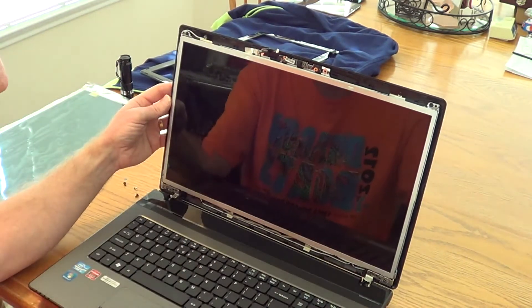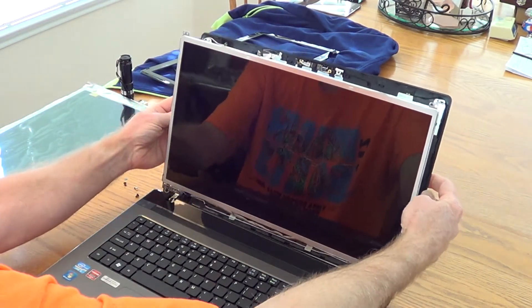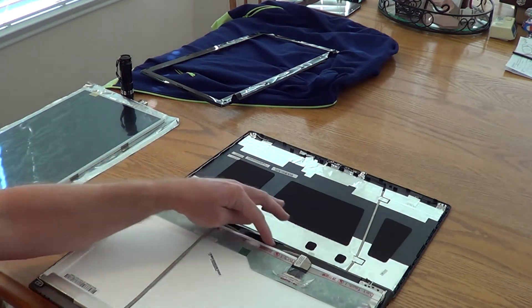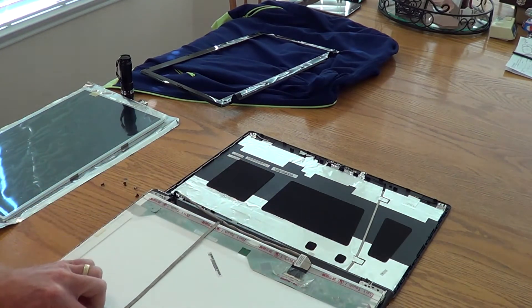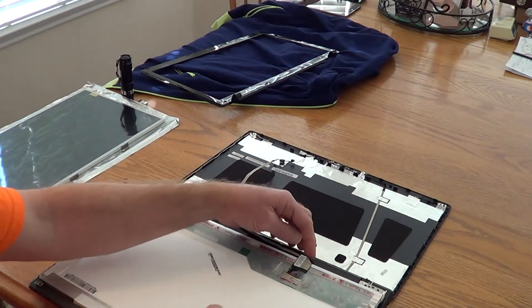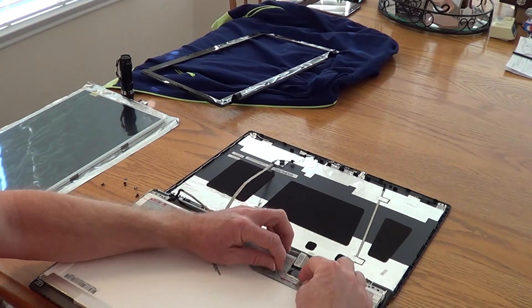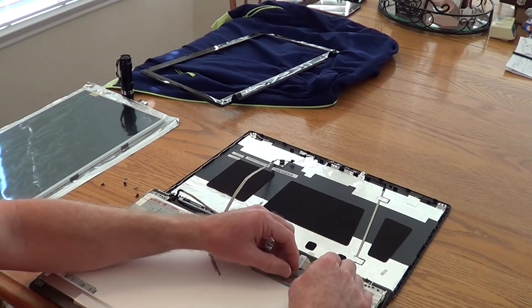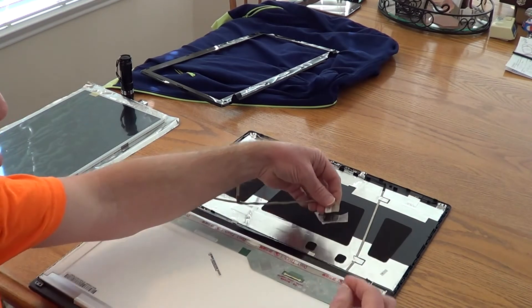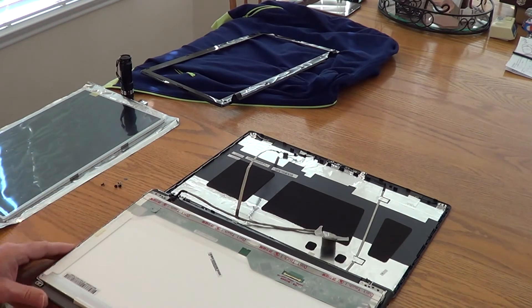We can now remove the two top screws. Then lay the laptop case top-down on the table and pull the screen down. Here's the main wiring harness — it runs over to the main connector, and another harness runs up to the camera connector we already pulled off. There's double-sided tape holding that — lift it up and off, same thing down here, lift the back side to release the double-sided tape. Take your knife and lift up the edge of the clear tape that holds the connector on. Once you get that loose, grab the back of the wiring harness and pull the connector straight off.